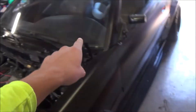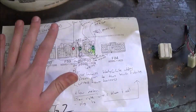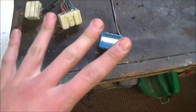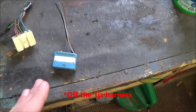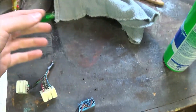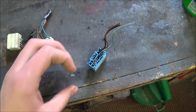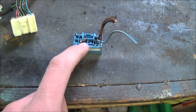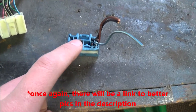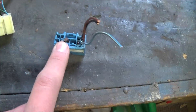And the red is when it's on crank — so we have the black crank wire coming in, attach it to one wire, and the one that needs the crank gets that signal. Those are the wires for the ECU — this part of your ECU wiring is done. I cut these plugs off of the harness that it came with because I'd already wired them up. On this blue plug, after you have the harness, you have five plugs and then these three extra ones that come off the end. There's a white wire, a black wire, and another black wire — these all go towards the starter. This thick black one is the one that gives the main signal to the starter. You just wire all three of these straight to that crank wire.